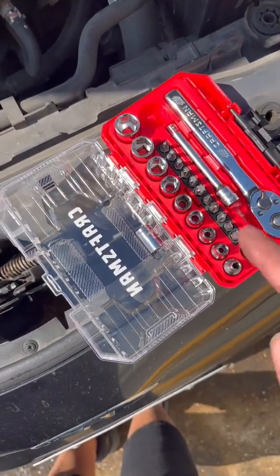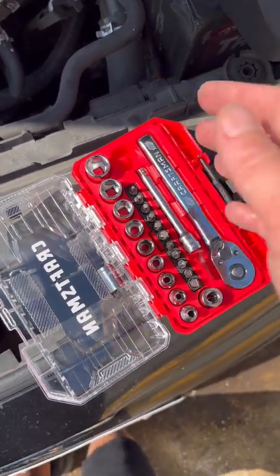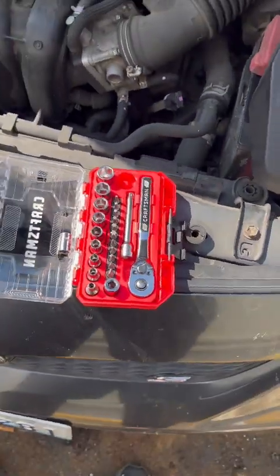Oh, you know what? I realized the one we need is actually this one. So I have it somewhere in my car. So I got the coils switched, 1 and 2, and I'll start the car back up and do that code reader again, and reset it, and then I have to drive around, I guess, for like 30 miles. He said it might be sooner, 5 miles.